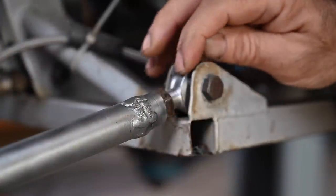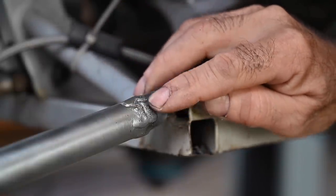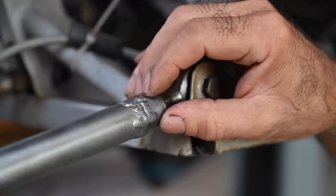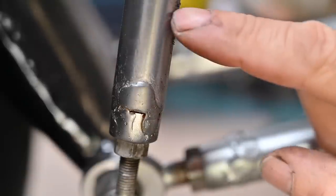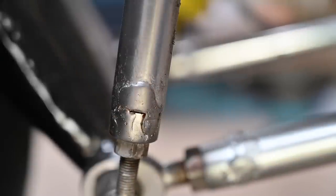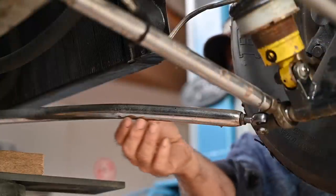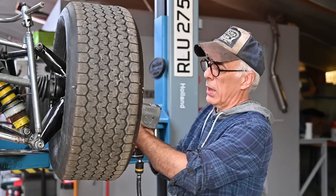On the left-hand side in the back there's a new ball joint, which is good. The rod has been cleaned up, but look at this weld - this is pretty poor welding and it's error-prone. This is a stress point and I don't like it - it will have to be reworked. On the same side you can actually see that the insert put into the tube is not fully welded - there's a crack or an area which is not welded. This rod is only for the anti-roll bar, but still, if you see that kind of thing, you better get it corrected.